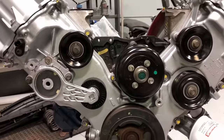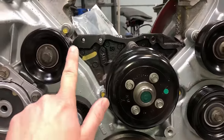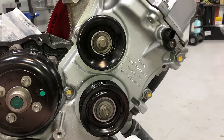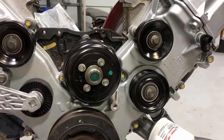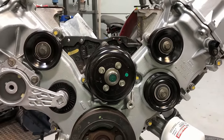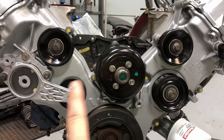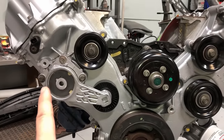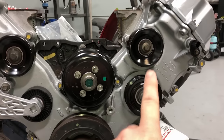The pulleys are a different story. Take the pulleys off the old engine and spin them — they should be perfectly quiet. If there's any whining or grinding noise coming from them, change them out to new. They're so common to fail. I replaced all the pulleys on this one. The torque spec on these is 18 foot-pounds for all of the bolts.